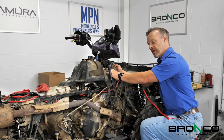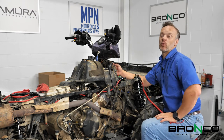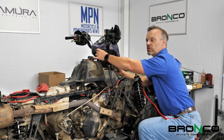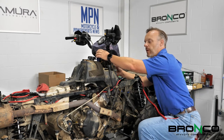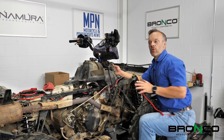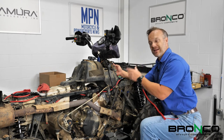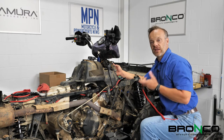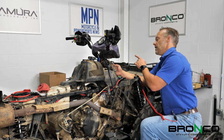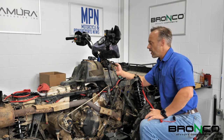We realize we're not getting fuel, but is it because the pump is bad, or is it that we're not getting electricity for the pump to work? That's the big thing we've got to look at. So I've got it disconnected. When I turn the key, I'm going to listen to hear the fuel pump relay click. The fuel pump won't run if the engine's not running, but it does have a prime cycle when you initially turn the key on, so it builds up fuel pressure so you've got enough to start the engine.